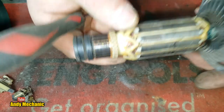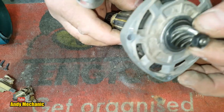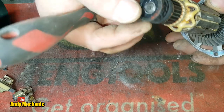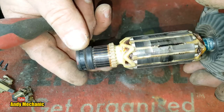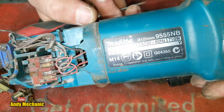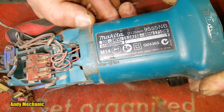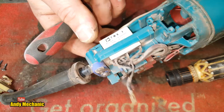I'll have to find out if we can get one of these and how much it's going to cost. We can remove the pinion gear at the end - there's a little nut on that, so the pinion can come off, the end plate can come off, the fan can come off. You can probably pull the bearing off too - it's got an anti-vibration sheath around that bearing. But it needs a new armature. I know the serial number - it's just there. So we'll go onto the internet and see if we can find one to purchase and how much it's going to cost. No point going any further just yet - everything else seems to be looking pretty good. Quick scan around the other internals - you've got the switchgear there.